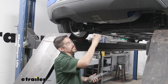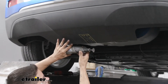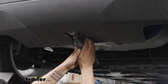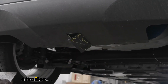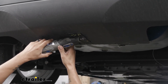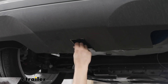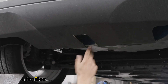I'm going to be using a rotary tool to cut it out quickly and make some nice clean cuts. Afterwards, we can come back with a razor knife or a file and clean up all the excess plastic, then take some rubbing alcohol and wipe off the paint from the marker used for marking.